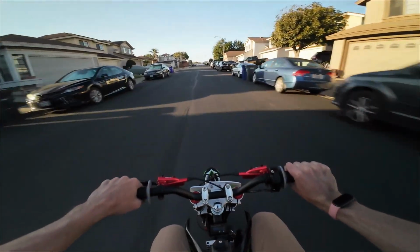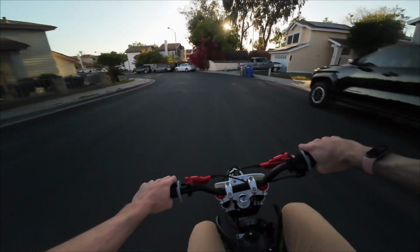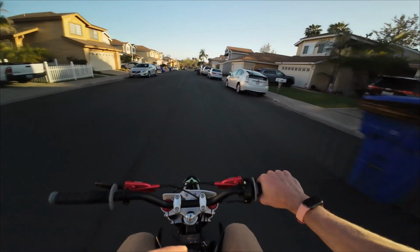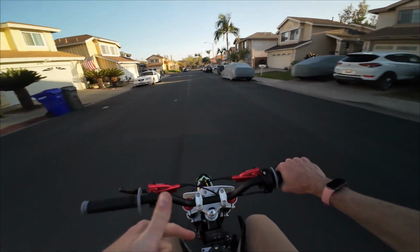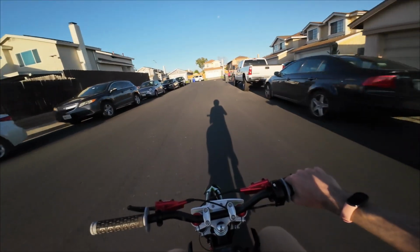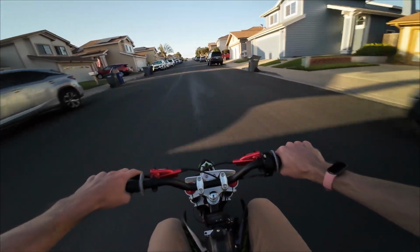Whee! Look at that thing go! As I go through the throttle and all the different speeds, it's very smooth, and I'm not getting that crunchy feeling at a certain RPM that I had previously with the 48 volt. So that actually debunks what I thought originally, that it was this controller that was the issue. So it was actually the bike itself. The tune is basically the exact same, so it's not in the tuning, but maybe it was the 48 volt motor, that 1600 watt motor. It just wasn't jiving with it. But it likes this 2000 watt motor just fine.